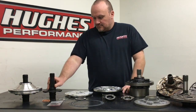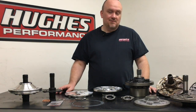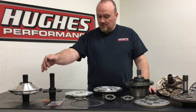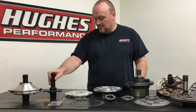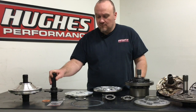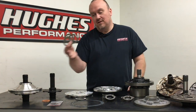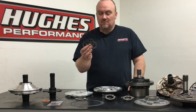That kind of covers our Powerglide pump offerings — there are other design pumps from other manufacturers and there's a lot of good stuff out there; this is just what we prefer. As far as small parts go, this pump uses OE-style stator sealing rings — our PTFE rings fit, and anybody's PTFE rings fit. You could theoretically put a cast iron sealing ring in there, but that causes premature drum wear, so we don't recommend it. We have shim packs available in different thicknesses; when you buy one of our complete pumps you get a three-pack of shims.